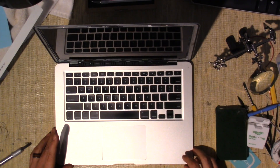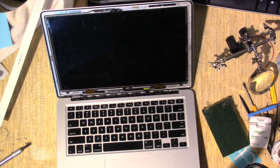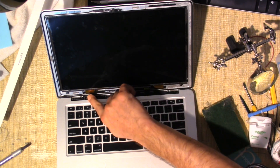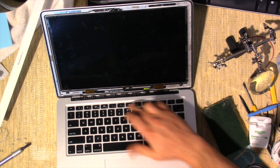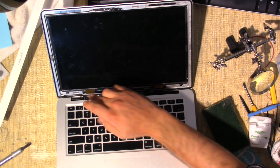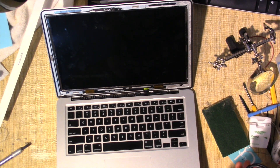So this is where I'm at so far — I took the bezel off; it's only glued on. The two parts you have to worry about when taking the bezel off are the camera and these very flexible, very easily ripped connectors to the screen. If you damage them — they're very easy to hit — you could just call the screen gone, because it's not going to happen. You need a new LCD from that point.